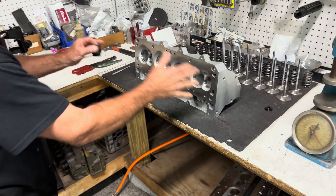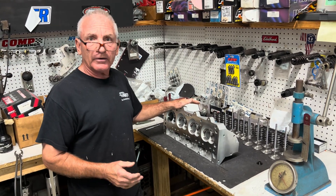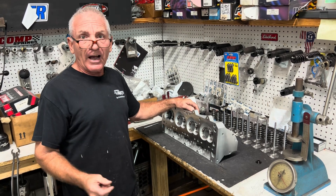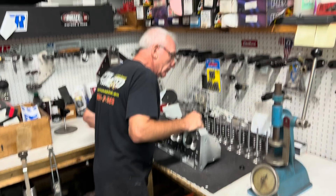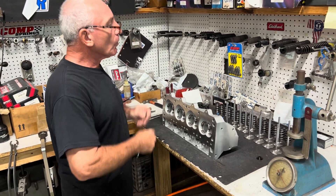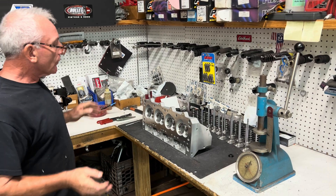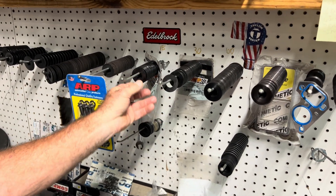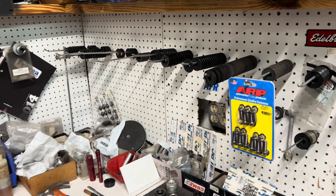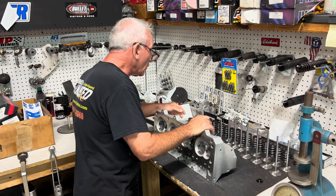With spring mics, we put the valve in place with a retainer and keepers and measure the installed height. If the mic comes up maybe 150 thousandths bigger than we want, we fix it with a spring locator. This is a spring locator — it goes in first, then we measure and determine how much shim to add. I have shims in 60 thousandths, 30 thousandths, and 15 thousandths sizes. We stack them under the spring locator until the mic reads where we want it, then grease the valves and put it all together.